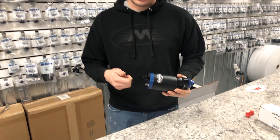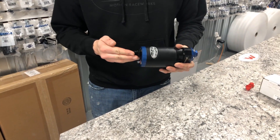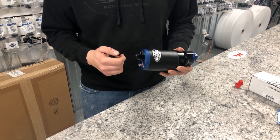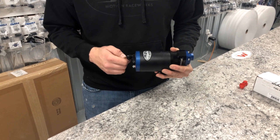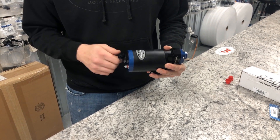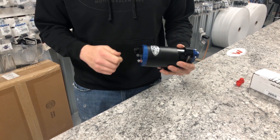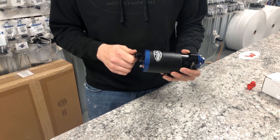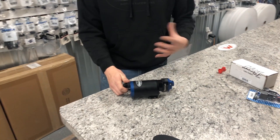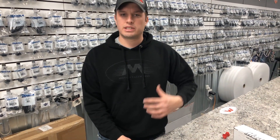As far as an outlet goes, an 8 works great on this pump, but a number 10 is better. I always tell my customers that number 10 fittings in-line really aren't any more expensive than number 8 — it's very nominal in its difference. So just go ahead and go to a number 10 fitting on the feed. That's a really important thing to help maximize this pump. If you're not getting full power potential out of your 750, you might have a 6 or an 8 feed — switch it up to a 10 and you're going to get the most. As far as return, I'd say go with a 10 as well. You can get away with an 8 return, but a number 10 allows everything to flow freer, the regulator can work better, and again you'll get the full power potential out of that pump.